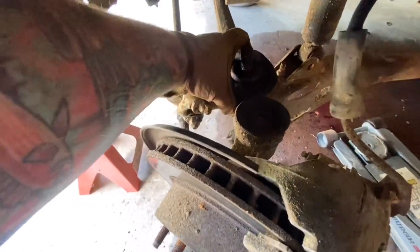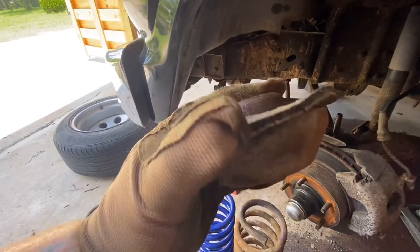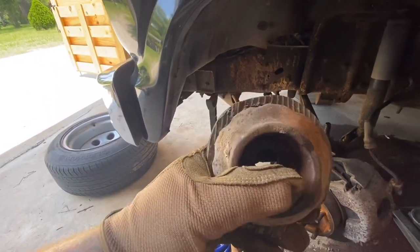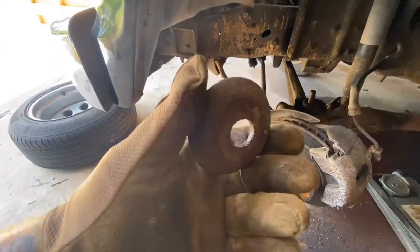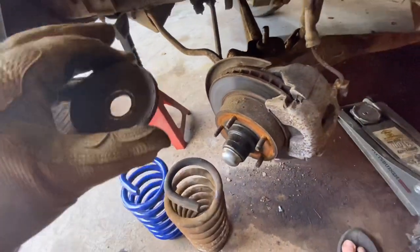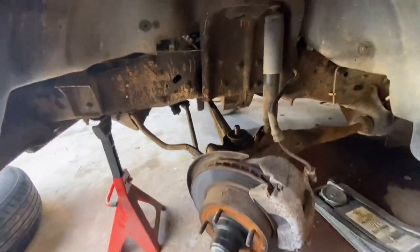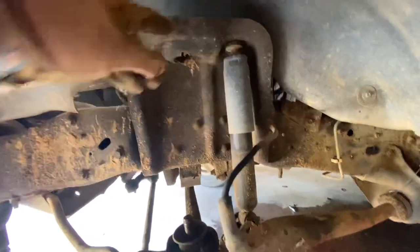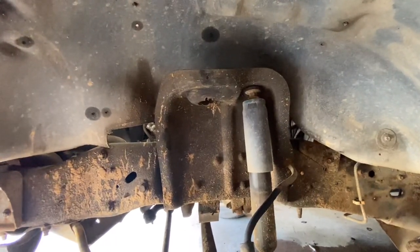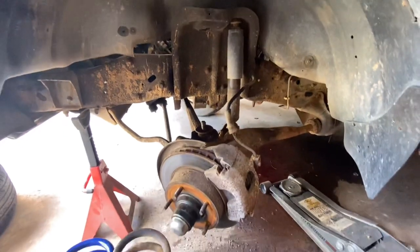This is what the springs rest on. There's a little rubber piece right here — I don't know if it's factory or somebody added it, but it's literally just the inside wall of an old car tire. This slides in and goes down to the bottom of the spring. This bolt right here is what keeps the spring on the perch of the I-beam, and the top orientates into that little pocket a specific way to hold it up there. There's a little clip that bolts in, and if the suspension were to severely droop — maybe your shock busted — it keeps the spring from just flying out.